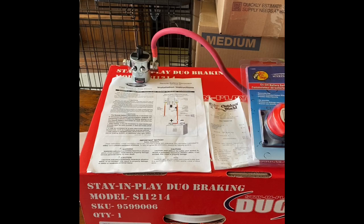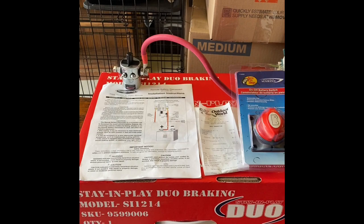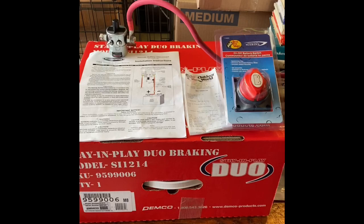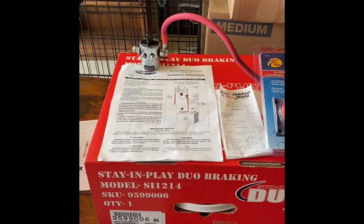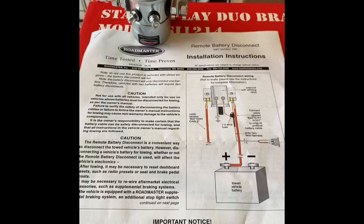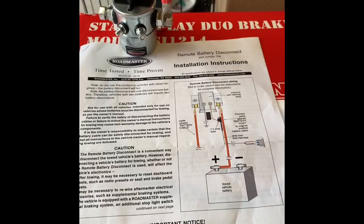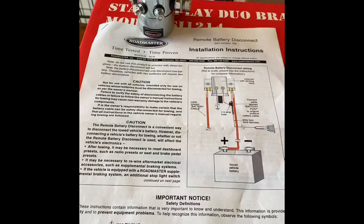When I finally got it all hooked up, I found I had to hold the enable button in and start the motor to get the thing to engage. It turned out this thing wasn't connecting at all when you press the button. When I started the motor, the alternator kicked in and I got power to run the rest of the system. I troubleshot it and found out this supposed latching relay does not latch - I don't know what kind of piece of junk they sold me. I was very careful, I didn't twist any of the nuts. The only bolt I put on was the ground wire, and the thing malfunctioned right out of the gate.